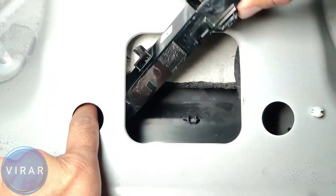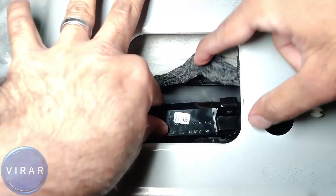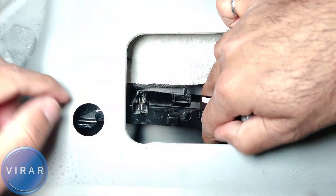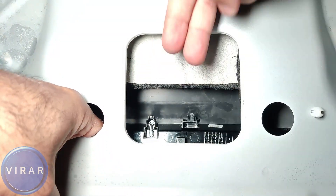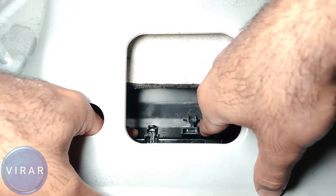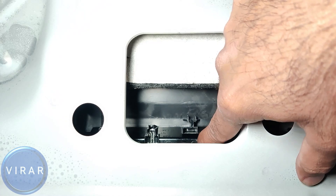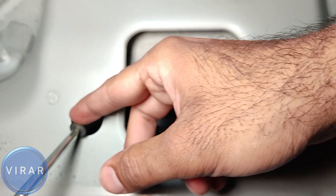When you're putting it back in, it's going to take a few seconds — be patient and position it the way I'm showing right now. Pay attention to the center clip, the small clip right beside the electrical connector. Once it's positioned, push it in the direction I'm showing — clipped, done. Pay attention to the position of that middle clip right there by my index finger.